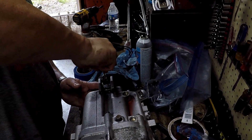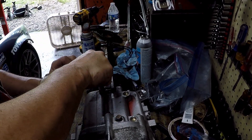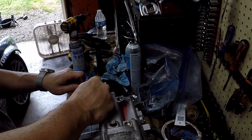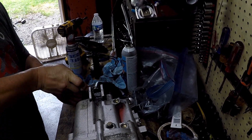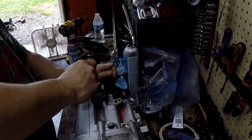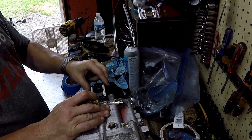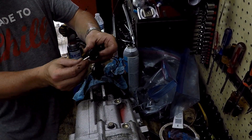The last thing I'm doing in this video is replacing the selector rod joint — it just seemed like a good thing to do while I had the transmission out. I'm switching over from the stock shifter to a tunnel-mounted shifter from Beamer World, which should make all the shifts feel a lot tighter. This is the last little bit of play in that system, so I went ahead and replaced it. The trickiest bit is getting the retaining ring off — it's not really a snap ring, it's a ring that holds the pin in place to get it up out of the channel. Once it's out of the way the pin falls out and it comes off.